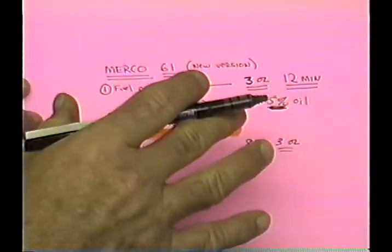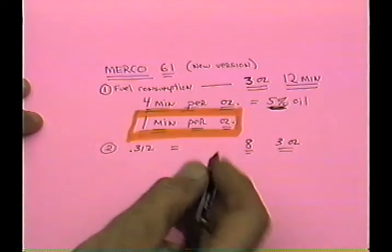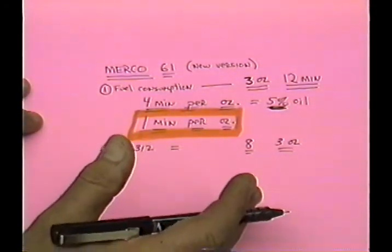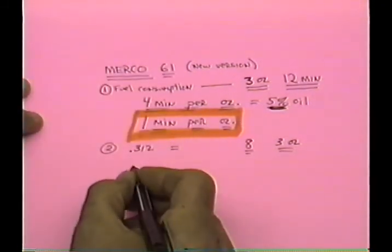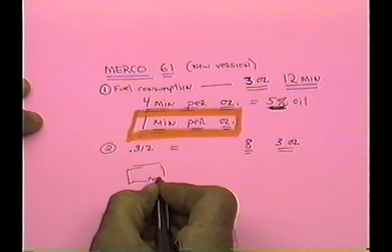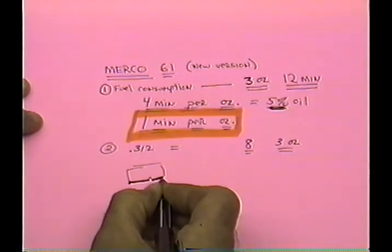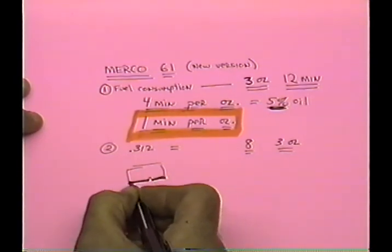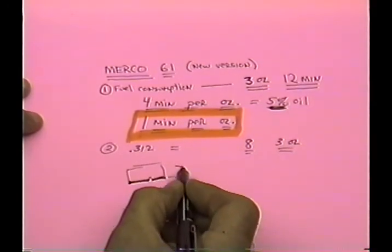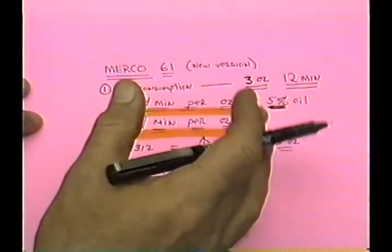Now the next step, and we haven't finished this yet, but we'll try to report in on it. He was shimming the head up, shimming the head down. As you shim the head up, as you add head shims, it uses less and less fuel. So my thought was he should take the head, Tom Hampshire can take it, and mill 20 thousandths off the bottom of the head. 20 thousandths is roughly the thickness of a typical Tiger head gasket, 20 to 24 thousandths. Because what Brian is trying to do is get the motor to use 1 ounce of fuel a minute.